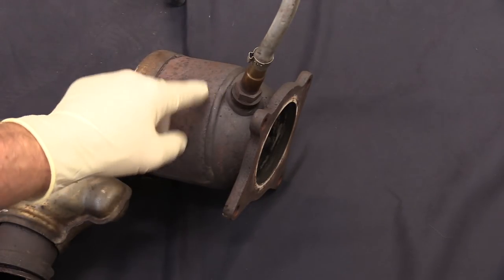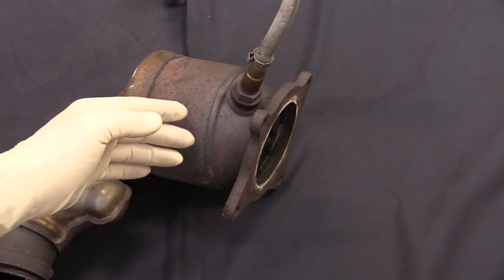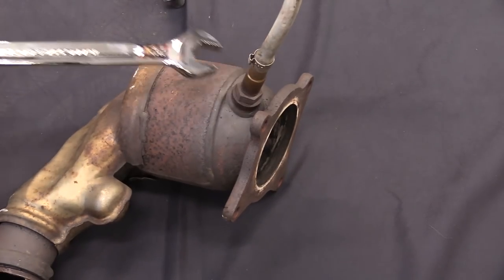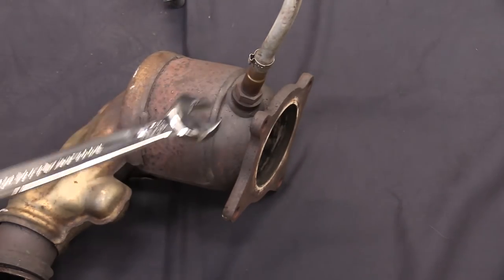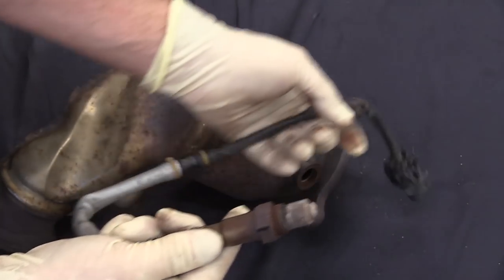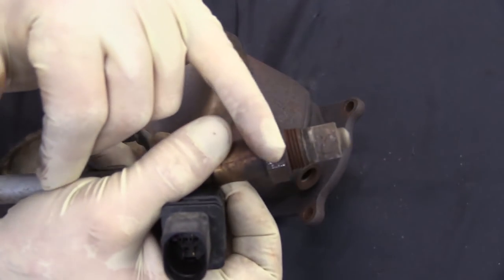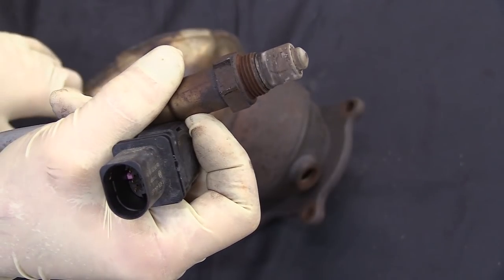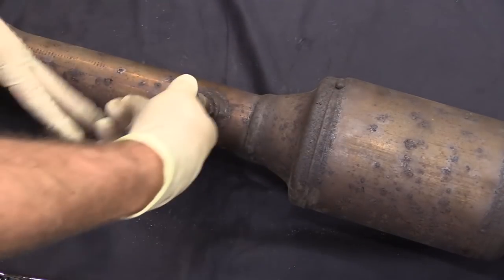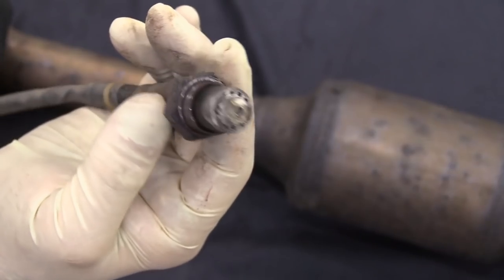You can break the O2 sensors loose while they're on the car, but the area is a little tight. If you have a vise, this is a really good place to use it. You also want to avoid an impact — like hitting your wrench with a hammer — to get the oxygen sensor out, as that can damage it. You can use either a proper O2 wrench or a 22 millimeter, which works really well on this application. Here's our front O2 sensor. The front and rear O2 sensors have different connectors so there's no way to swap them around and get them plugged in incorrectly. We'll go ahead and put a little bit of anti-seize on the threads only. Given the condition of this O2 sensor and the state of the rest of the entire vehicle, kind of surprised this actually came out. Now we can take these and get them into our new exhaust.